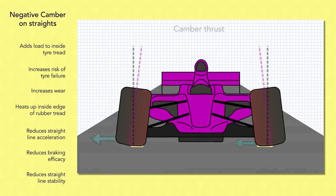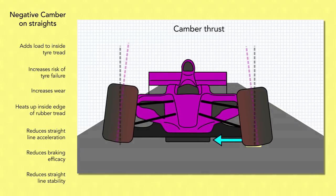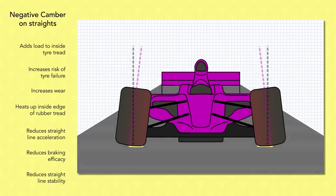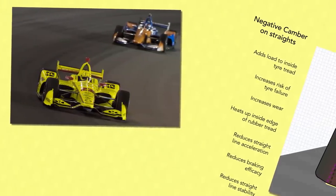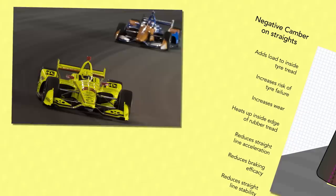Furthermore, the lateral thrust we spoke about — the tendency for a cambered tyre to push the car inward — is normally fine on straights as the left and right tyres balance each other out. But if one tyre loses some traction or load by hitting a bump, the other tyre's lateral thrust will dominate and jerk the car over a little bit. This can make the car more sensitive and twitchy in a straight line if overly cambered in. You don't really see this much in F1, but in IndyCar where they race on ovals, they may really crank up the camber to use the lateral thrust through the long banked corners, but be much more unstable down the straights — riding very much on tiptoe.